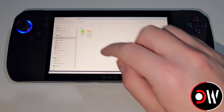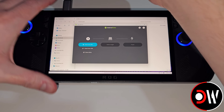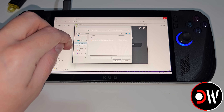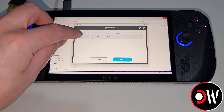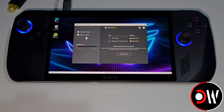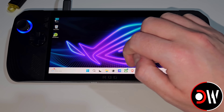Once both files have been downloaded, let's run Balena Etcher, and once loaded, we want to connect our USB-C adapter and USB stick. We want to choose Flash from File, then go to our Downloads folder and choose the Steam Deck Repair image that we downloaded previously. Now we want to choose Select Target, select our USB stick, press Select, and then go ahead and press Flash. The SteamOS recovery image will be written to our USB stick. Once completed, we can skip Validation, close Balena Etcher, hold press on the Start menu, and press Shut Down twice.